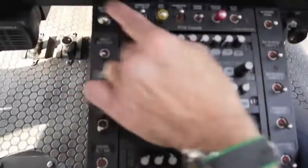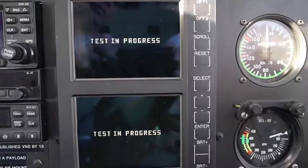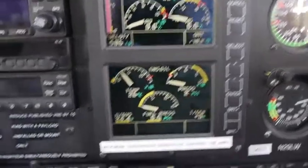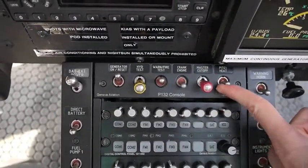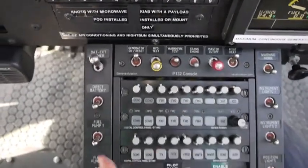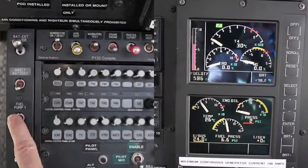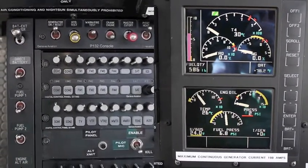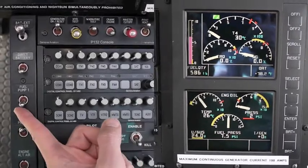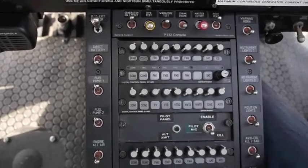Let's come up to the switches. We've got the battery on, and now we're going to wait for the VEMD display to come on — it takes a couple seconds. There it is, now we can proceed. Generator on. Pitot heat on. Now we're going to check the fuel pumps: turn the first pump on, look for a rise, turn it back off. Second pump on, look for a rise. Then make sure the fuel warning light turns off — turn the second fuel pump on, and that warning light comes off. Now we're ready to get it started.